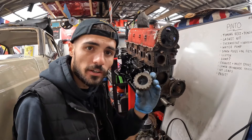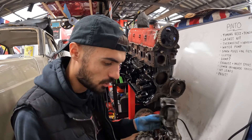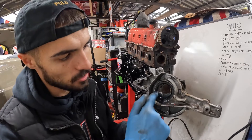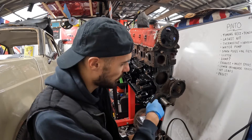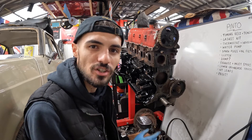I've had a little bit of trouble getting this crank sprocket off, but I've used my initiative - I've wedged the screwdriver in there. There weren't a lot of play so I just gently went around and from the bottom as well, because I've removed the sump, just gradually getting it out nice and square. With that sprocket all removed I can give that a good clean up. The main thing is I've got the oil seal cover off, and there's your oil seal just hiding in there. What I'm going to do next is clean up all of this area, wire brush all of the old gaskets off, and then we get to fit some new parts.